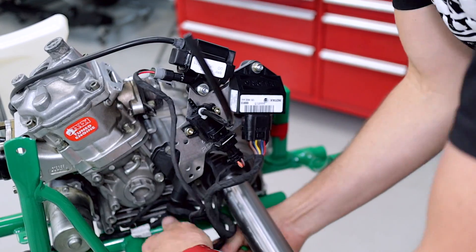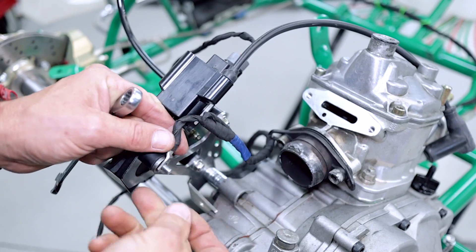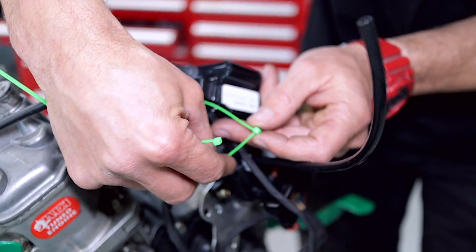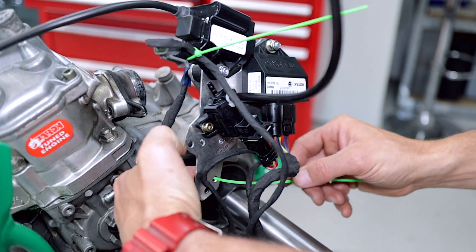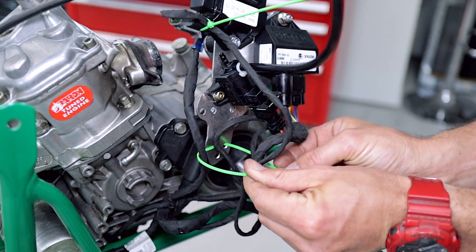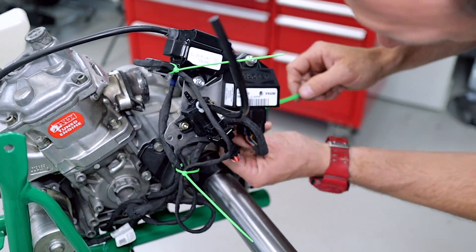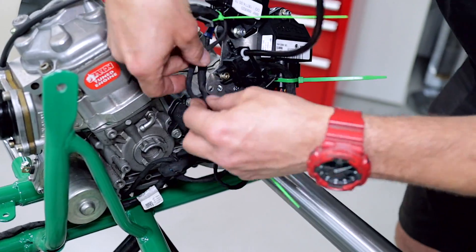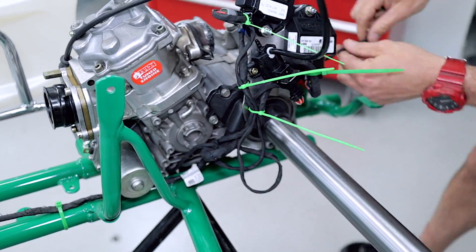Now it's a matter of just plugging all the sensors into the harness — it's pretty straightforward. Connect the earth strap, making sure it's on the one closest to the engine on the other side that's insulated. Then we're going to tie the harness back to the coil and then the harness down here to the bracket. This is to stop the harness weight when it's vibrating as you're driving from pulling on all the sensors and breaking all the pins out. Zip tie those back to the sensors and put a couple of extra zip ties on to really neaten the job up.